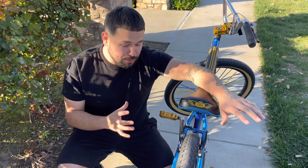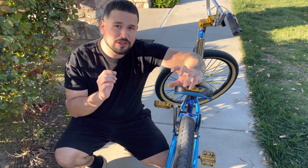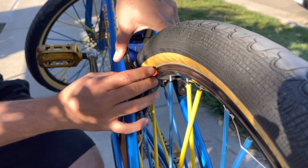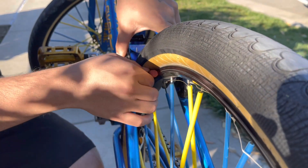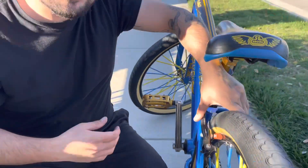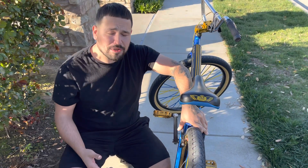Line it up with the wheel snug tight. When you first put the pads on the brake arms, keep them a little bit loose, grab the brake arms themselves and push them towards the wheel, then adjust the brake pads, and go back in with your allen key and tighten it up. That's the easiest and best way to adjust and prevent misalignment.